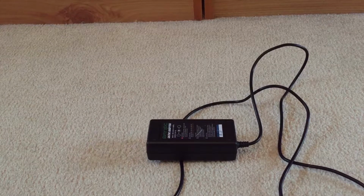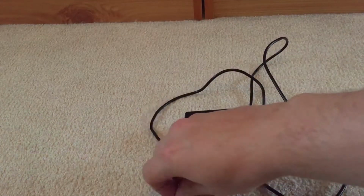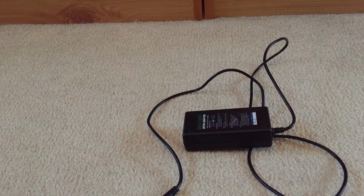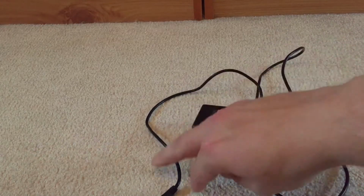Obviously tried reseating all the cables, including the power supply. Still the same. Tried running just the Mega Drive on its own with this power supply. Still got the speckles going up the screen. So I tried using a genuine Sega power supply for all three of the devices, the Mega Drive, the Mega CD, the 32X. No such problem at all. So this power supply seems to introduce noise into the picture.